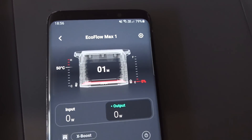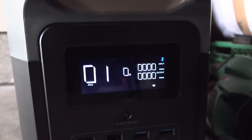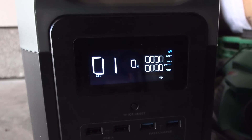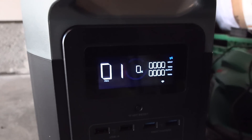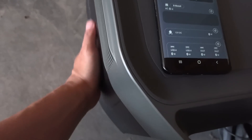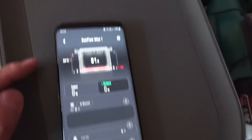I'm trying to charge it back up now, but you see it's not charging — it's plugged in, it's on, but it is rapid gating. You can see the display — there is a temperature warning blinking there. So I simply cannot charge right now, it needs to cool down. And it wasn't even that hot today. Can you imagine using this in Thailand or somewhere warmer? We just have to wait for it to passively cool down before it starts charging.